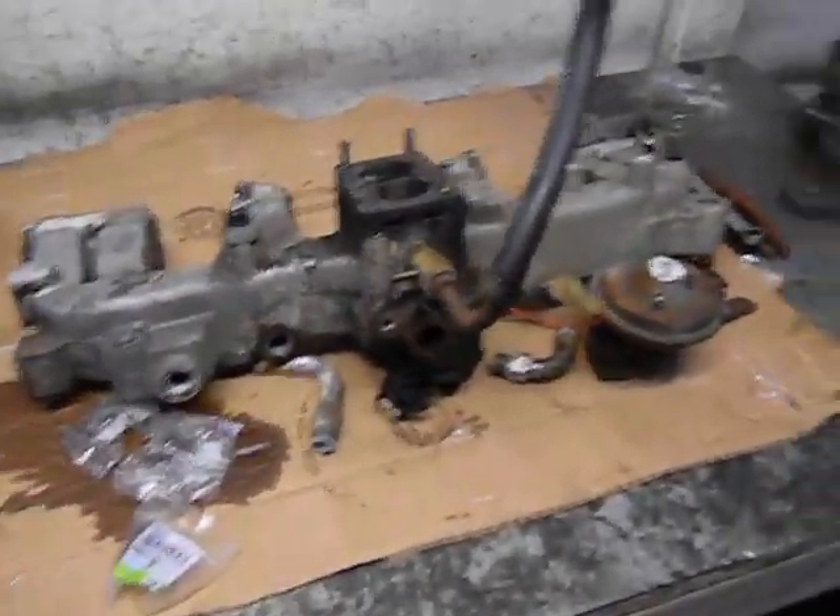So I'm going to plug all this stuff up, clean this intake, pull the studs off, and paint it. When I go to put everything on you'll see the updated video. For the exhaust manifold, we're going to use the one from the '97 - it's a much better design than the one from the 1990. It does have one leak right here which I've noticed a lot of them have, so I'm just going to weld that up and paint it, then I'll do another video.